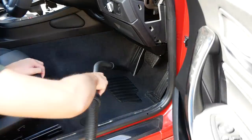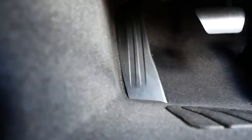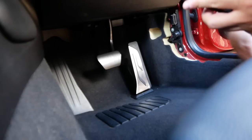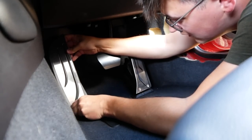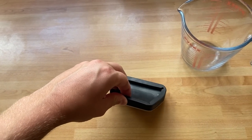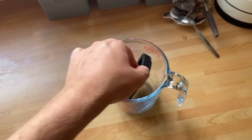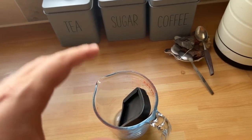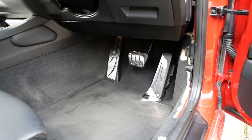Moving on to the next modifications — these aren't anything out of the ordinary, I've done both of these in previous cars. First of all, we're going to go ahead and stick the pedals in. This is so simple — you simply take off the brake pedal cover, put the new one on, stick the footrest on, and then slide the accelerator down over the top, and that's completely done. A quick tip: it might be a little bit tight because the rubber is really tight. Put it in a jug and fill it up with hot water for a couple of minutes, and it will become really nice and loose so you can put it over the pedal easily. When it's cold it'll go solid again. I bought these pedals from R44 Performance — I'll leave all links in the description.